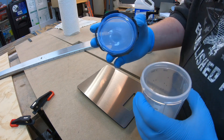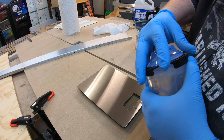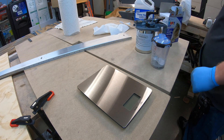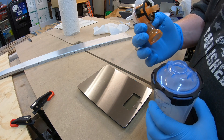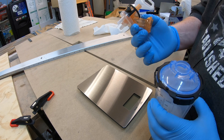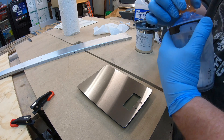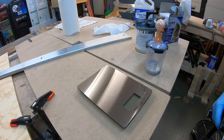What I like about the 3M system is the lid has a built-in filter. When you put the lid on and place it on the air gun, it filters the primer as it enters the gun, eliminating the need for a separate filter step. The removable nozzle caps correspond to different spray viscosities — I'm using a 1.4 millimeter tip today. If you wanted a heavy build, they recommend a 1.8 millimeter tip. Going with the 1.4 and diluting 10% with water should give a slightly smoother finish. Now I'll get the air gun set up and we'll be ready to start priming.